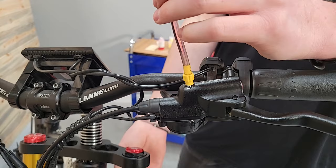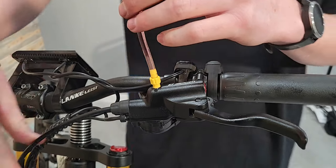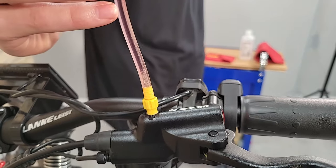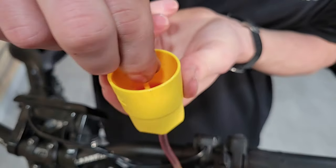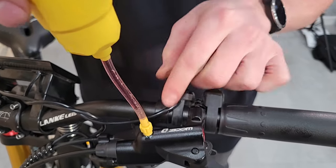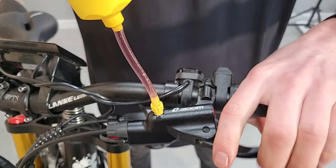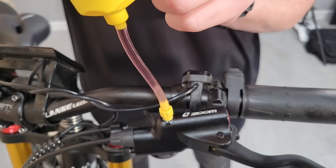You can kind of flick the line. This line runs all the way up on the inside and all the way to the back here, so most of it should be heading uphill to get here. There might be a couple of kinks in there, but for the most part we're pretty good. It's already getting firmer as I'm doing this, and now I'm kind of running out of bubbles. One thing you can do — I'll bring this little plunger back. If I put it in with a little stopper in the hole, I can kind of push this in and pop a little bit. It helps break up bubbles that are sitting close and don't want to come out unless you have a little bit of force using a vacuum — causing just a little vacuum to kind of change the pressure. Then I'll go back to squeezing it for a while. Just keep doing this until I don't see any more bubbles come out.